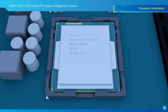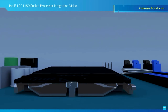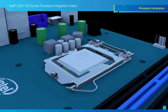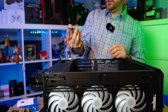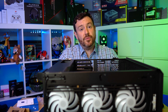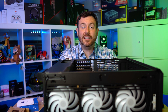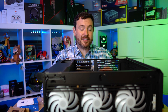We simply take this, drop it in, close our heat sink shield — and by the time I press this down, that'll pop off, just like that. You can discard this protector; no longer needed, but you might want to keep it should you need to send the motherboard back or take that processor out, as it does act as a good shield. Literally, that is all it takes to physically install the processor.